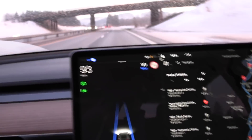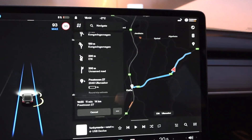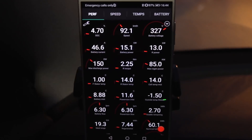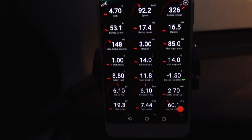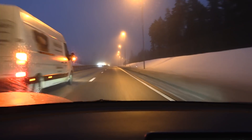So far so good — heading towards Klufta, the cleavage. We are on the E16 towards Kongsvinger, taking a little loop to the east and then back again. We will arrive with roughly 1% left. We have 5% battery and still no power limit. The power limit reported is 150 kilowatt, which is incorrect — we should have something like 180 kilowatt. The battery has chilled down to 14 degrees only, but we still don't have any cold weather issues. This LFP battery is doing very well in minus 2 degrees Celsius.